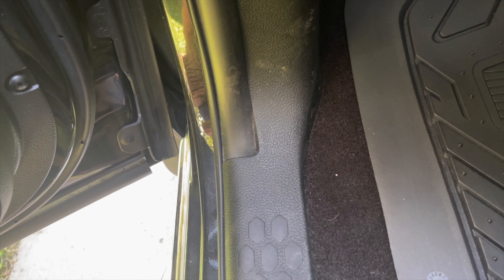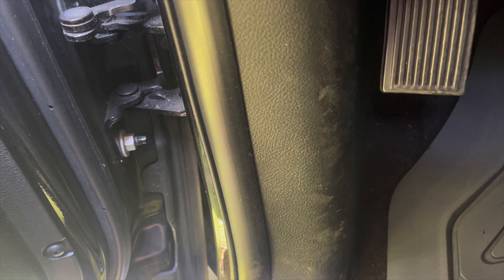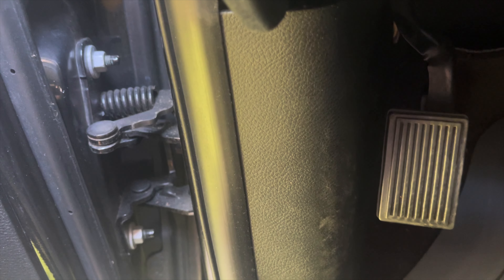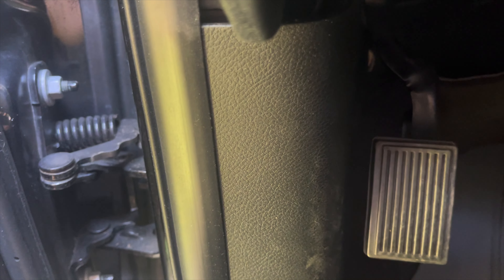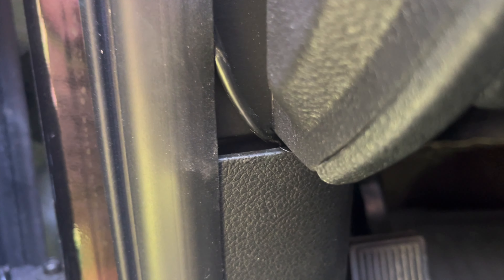For this next stretch, once I get to the front lower part of the dashboard, I go up behind the plastic piece next to the emergency brake and then pass underneath right here. I'll tuck this wire so it won't show. Then, to get above the windshield, I follow it all the way up and across to the headliner.